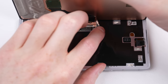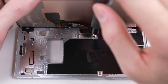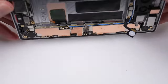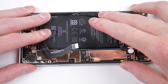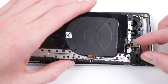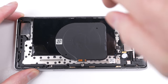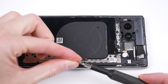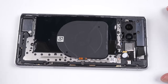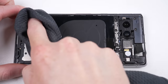I'll plug the screen in before attaching the battery. Although Google's phones are designed to allow the screen to be plugged in while the battery is attached, it still just feels incorrect. As I don't have any proper adhesive, I'll just be reassembling the device without any and come back to apply the proper stuff once it's released. Next to go in is the battery along with its accompanying bracket, followed by the wireless charging module and its 15 screws — this plastic section actually secures a lot of the components below it. The tiny screw goes back in its right spot, the LED flash is re-adhered, and the SIM card tray and back panel are reinstalled.